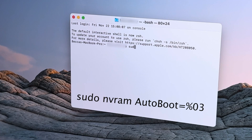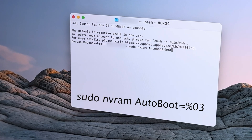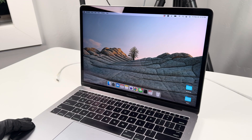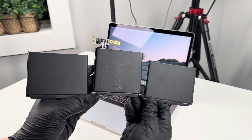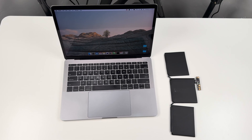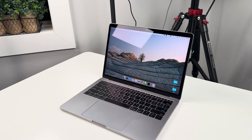I've verified the battery is working correctly, so I'm going to enter the script in Terminal to make sure that the computer boots up when the screen is opened. And now we're done replacing the battery for a 2017 A1708 MacBook Pro. All the tools I used and the battery are linked below. If this video helped you, please go out and help someone else. Thanks for watching.